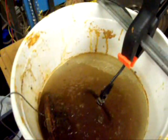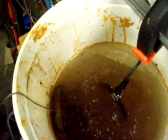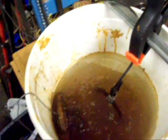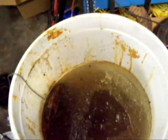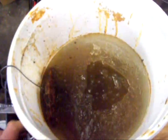The solution in here is just one gallon of water to one tablespoon of washing soda. Now I've heard baking soda works too, but I haven't tried it. If you can't find washing soda, what I did was I took baking soda and put it in the oven for about an hour or so, and that will cook off all the excess water and release carbon dioxide, and what you'll end up with is basically washing soda. That's what I did because I went to a few places and couldn't find it, so I just made it.